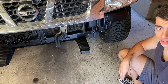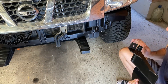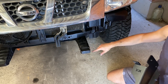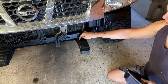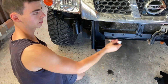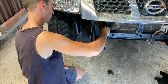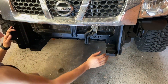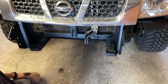The instructions are by far not the greatest — not many photos — but from what I can see, and from the old stuff as well, that's your bracket on this side. You've got your two hole positions for the bolts and your two pre-existing ones from the original bar. This will sit on like this and there's a top one here — all you have to do is mark that out and drill it through and bolt it in. I've had to take the condenser fan off on this side to mark it and drill it, but there are literally just three bolts — one at the top, two at the bottom — and the whole fan comes out. Both bull bar mounts are on now. I bolted them at the bottom on both and then there are the two on the sides, so now we're getting on to actually fitting the bull bar.